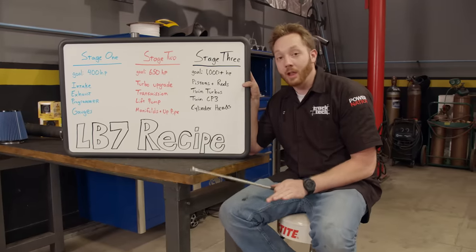Our final spin yielded 374 horsepower and 684 pound-feet of torque — that's an overall gain of 136 horses and 254 pounds of torque over stock. And we're not done yet. Stage 2 we'll try and double these numbers with additional upgrades including a bigger turbo, high-flow manifolds and up-pipes, and fuel system upgrades. If you own a 99–07 Silverado and live anywhere near the rust belt, then you recognize this. We'll take you step-by-step through the process of rocker and cab corner replacement.